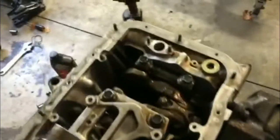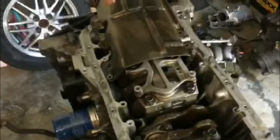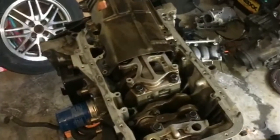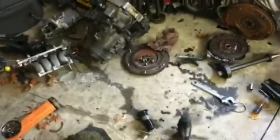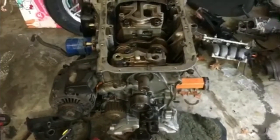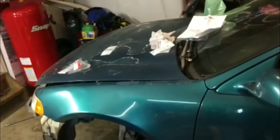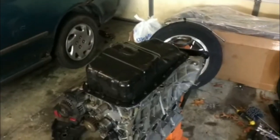Got the rear main seal on with some new sealant. There's a gasket there — don't forget to put that on. I like to use the gasket instead of any kind of sealant because sealant can get caught up in there and clog up the oil pump and you'll have a bad day. Just use the gasket, put your windage tray on, clean up the oil pan, put that on, and everything will be sealed up on the bottom. Then I'm gonna time it and put the cams in while it's out — it'll be a lot easier.